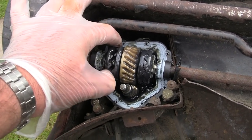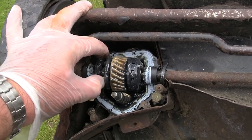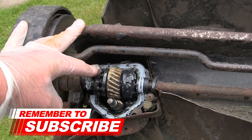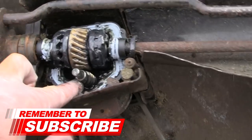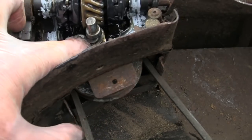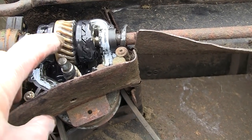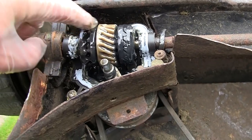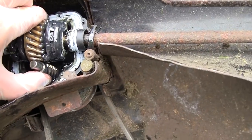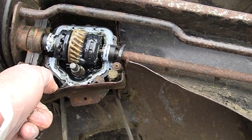If you've got a mower with a self-drive that don't work, it's very rare, without changing all this box over, that you're going to ever get it working again. But I wanted to show inside this box. I've done it on some other videos. And what happens a lot of the time is this part here, this is a metal gear, the worm gear, and it actually runs against this plastic gear here. And these, over time, just get worn out and they just wear away to the point where they don't contact enough. So, you pull that lever again for me.